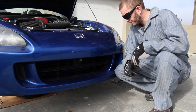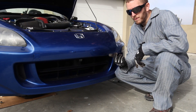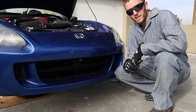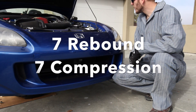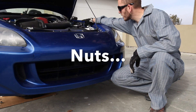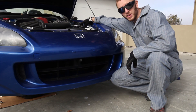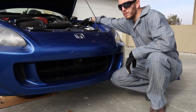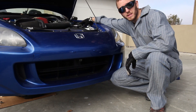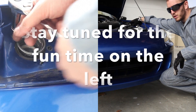Here's the deal. The next thing I'm going to do is lower my front suspension down five turns on each side and then make sure each adjustment is set to seven and seven. One thing I've noticed with the KWs is these top bolts — there are two that come with each suspension piece — and maybe it's because I don't use Loctite on them, but they tend to come undone. So I'm going to double check all of these nuts on top of the coilovers and also in the trunk. The trunk one's a little harder to access, especially by the gas inlet. So I'm going to lower the front suspension and check the bolts on it.